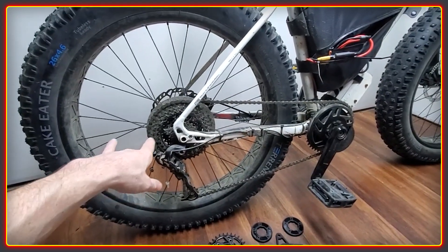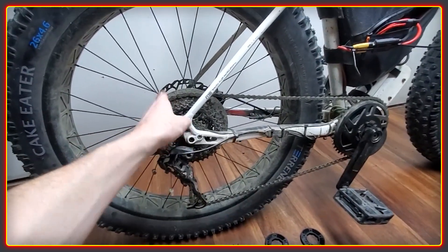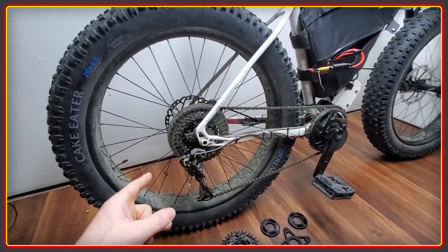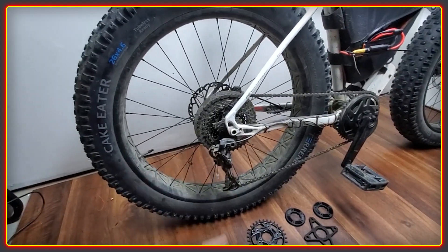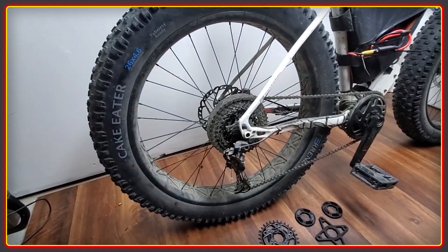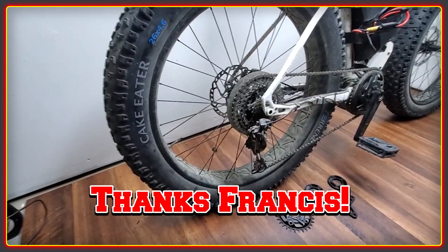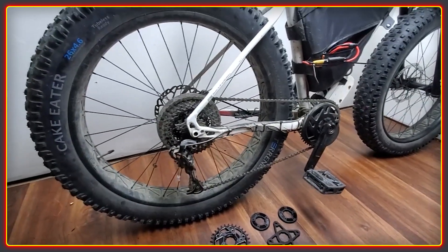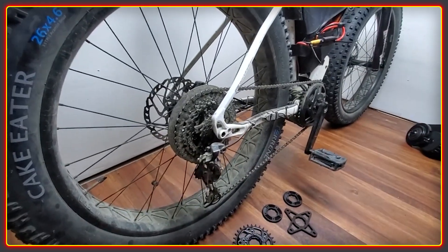This bike, for example, I can hit 60km/h with ease in this big gear at the back, and that is a 1-to-1 drive ratio. So I effectively have a single speed setup here on my fat bike. It's very much inspired by the work of Francis Janssen at Electron — the guy has a wealth of bike building knowledge and is ultra generous with it, and this is one of the things I picked up from him early when I was building my first bike.